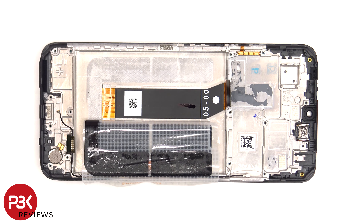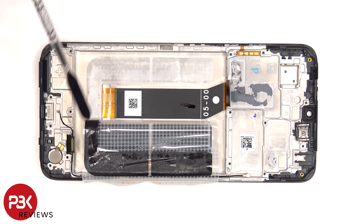If you needed to replace the screen you'd have to remove the back housing, the screws on the top and bottom covers as well as remove those covers themselves, and then you'd have to disconnect both of these flex cables as well as the battery flex cable and pry the battery off.